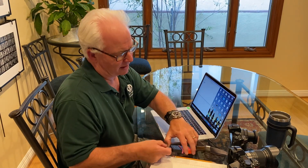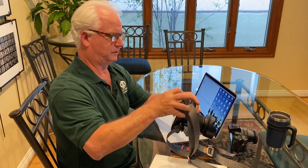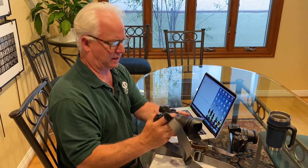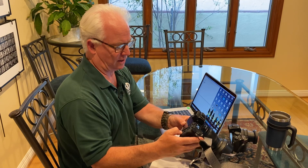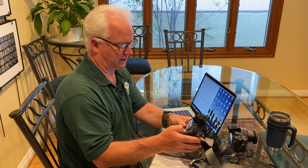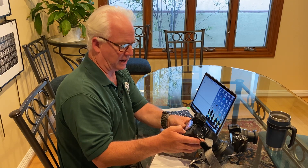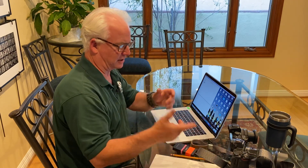Now to update the lens, I'm going to put the memory card into the camera just the same way. It needs a full battery and the lens needs to be on. Turn the camera on, hit Menu, go up to Firmware Version, update the firmware version. Yes — so updating the firmware version on the lens. It takes about two minutes. Oh my gosh, the lens is done already.